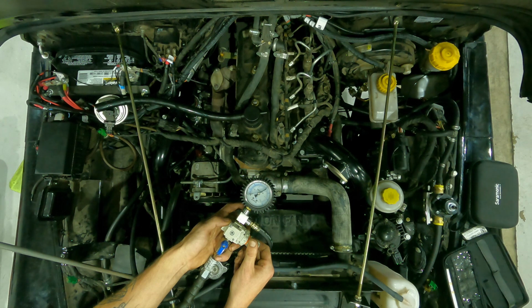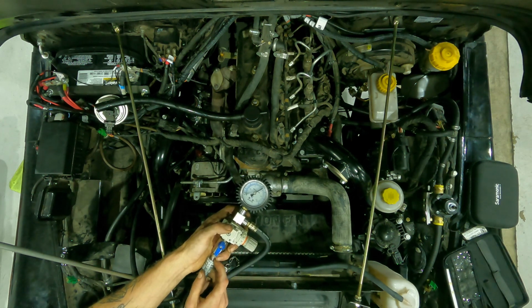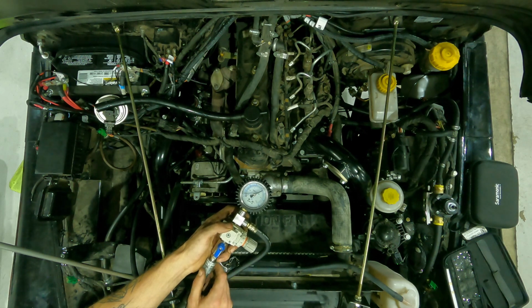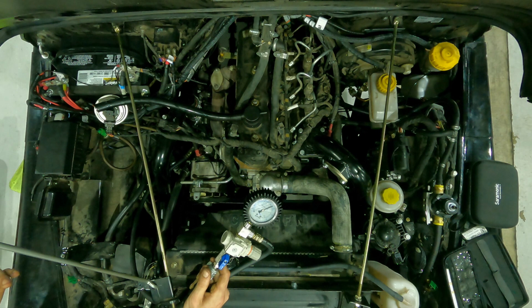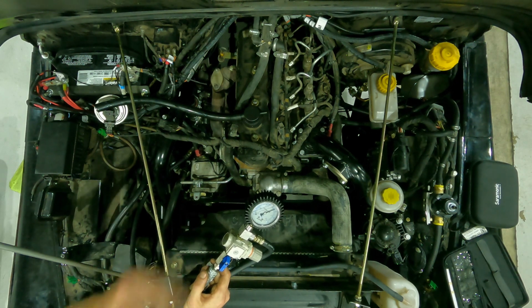Seems like we're holding. I don't hear any giant, really loud hisses, which is one of the guaranteed spots of finding a boost leak. Now, the other way to watch it is, once you finally set it at the 20-25 mark, wherever you're going to land with that vehicle, to watch how fast it drops. Yeah. So can you explain why it does drop a little bit of pressure, why it slowly does bleed off? Yes, now with EGR equipped trucks, you're going to have small amounts of bleed off, plus the exhaust valves aren't always perfectly seated in the head. So you're always going to find a little bit of leak down, but like you said, the best way to test this is to disconnect your shop air, because right now it's got a constant supply of air.